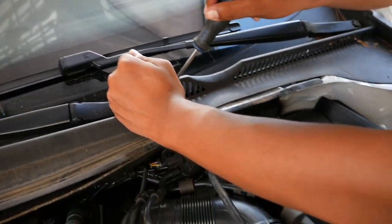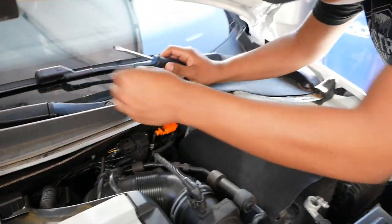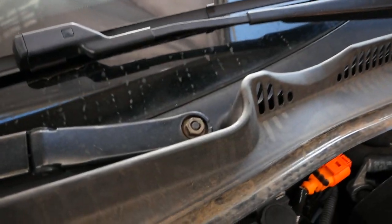With the flathead, you're gonna cover it and you're gonna pick up the notch. And then that exposes the nut there, which is a 13 millimeter right there and there.